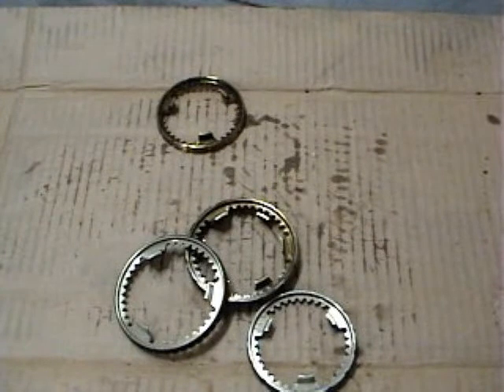So in my experience, usually the transmissions just need a reseal, new synchronizers, and a one-two shift collar — and that's it. People sometimes tell you that the gears break and this and that, but if your only issue is not going into first or second, it's not the gears, it's the one-two shift collar. You obviously have to inspect the other side where the shift collar engages the gear, but usually that can just be taken care of with a file.